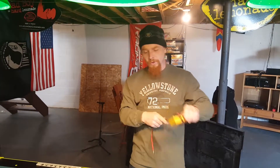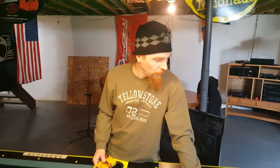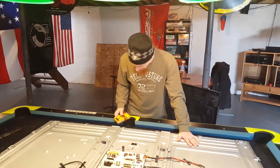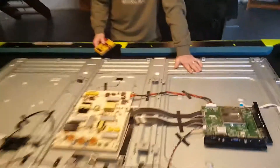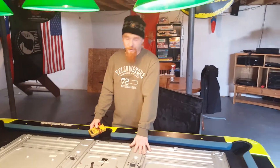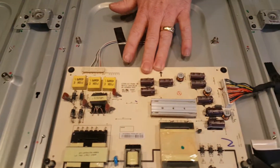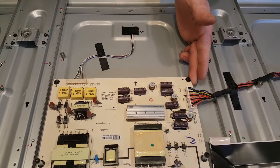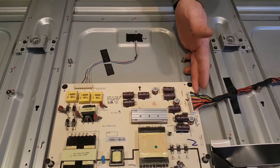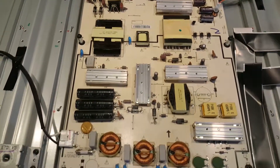This is all the further diagnosis I'm going to do on this, because no voltage. That means we don't have to change the LEDs — LEDs are really not fun to get to, as I'm already questioning how to get to the ones on this with thousands of little screws. It's almost fatal for a set to lose a set of LEDs or your backlighting. So in this case it appears it's going to be the power board. We're going to go on eBay or on Shopjimmy.com — they're not sponsoring this by the way, but I find them a good reliable site for parts. So we're going to find this board for this Vizio on Shopjimmy, and we'll give you an update from there.